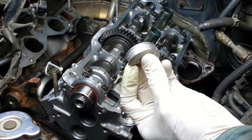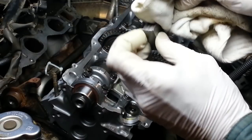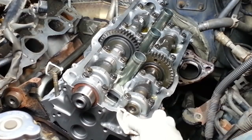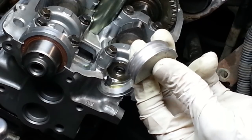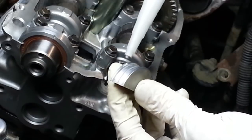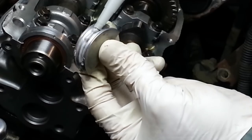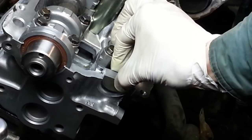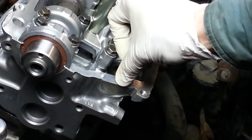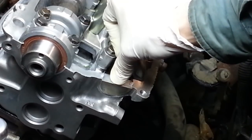Now you remember my semicircular plugs, I want to make sure that those are nice and clean, so rag with some acetone, and also where they go on the cylinder head. Now these semicircular plugs get just a little bead of RTV silicone. And it sets right down into that little groove. Do it in one shot, not to make a mess. Same for the one in the back.